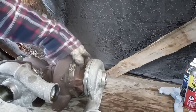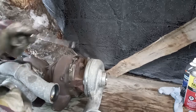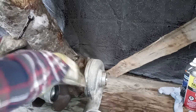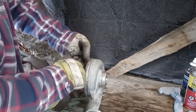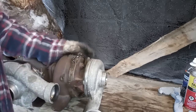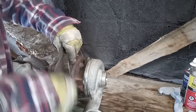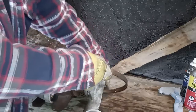This clamp right here holds the two parts of the center section and your exhaust housing together, and that's an 11 millimeter wrench. I'm just going to pull this clamp right out to make life a little easier. Just be gentle — try not to stretch it out too much.